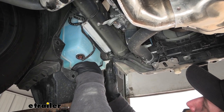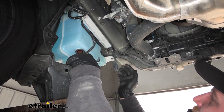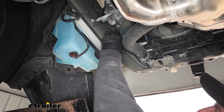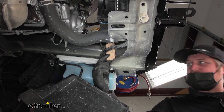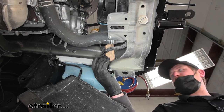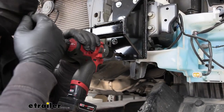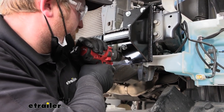Over here on the driver's side, if you look on the back side of our frame rail, we're going to have some wire loom that we need to remove out of the way — eventually we're going to drill through here and put a bolt and we don't want to hit that. Take the trim tool and pop that out of the way, which will allow us to push it up and out of the way when we're drilling. Before we start drilling, we're going to use the base plate as a template. I took a block of wood and jammed it up in there — not only will it help pull our wiring away, but once the drill bit comes through, it'll just hit the wood and we don't have to worry about it damaging our wiring or another component. Take your drill bit, run through, and try to get this as straight as possible — be careful and deliberate. It's pretty thin metal so it won't take too long.